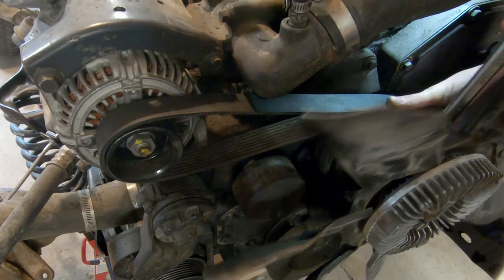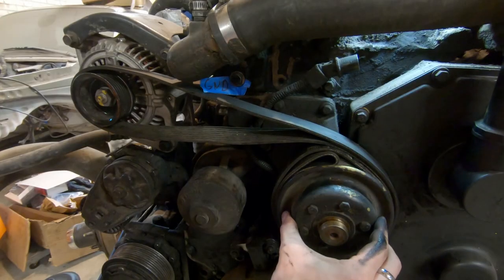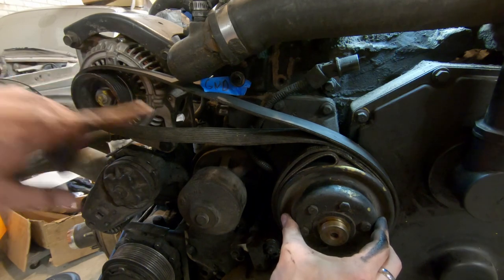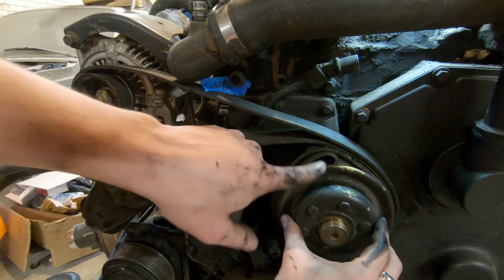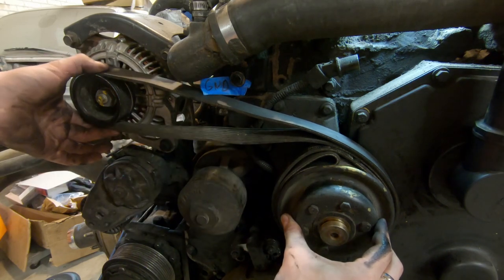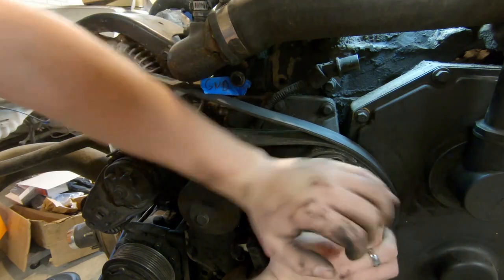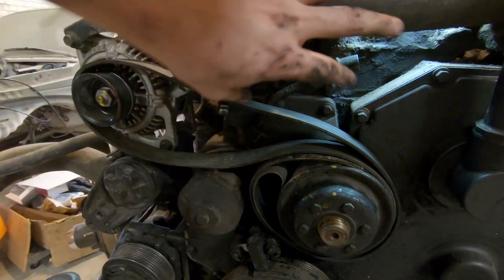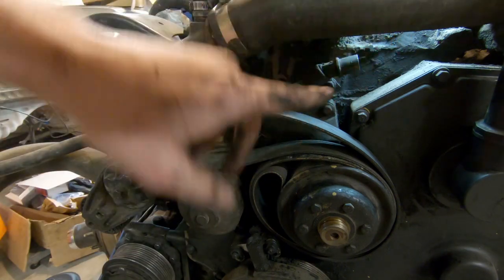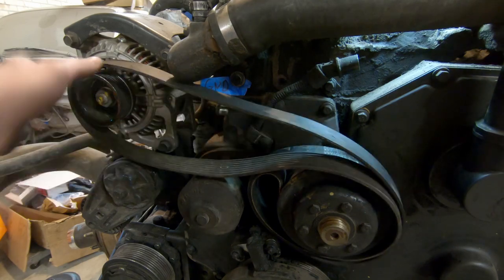Maybe that trick would work for you too if you're trying to do something like this. With the fan off, this is a better perspective on what I did. I wrapped it around here two and a half times and then grabbed the other end on the alternator — it is very firmly held there, I can't rotate it by hand. This is why it's really important that if you have a big supercharger up here, the belt wraps around it as much as possible, because it really changes the amount of friction.